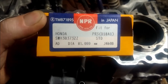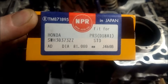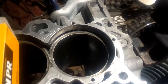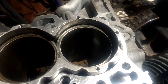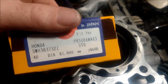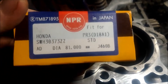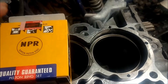Confirmed garbage. I know some people have had luck with them, but most people have not. They say they're an 81 millimeter, and that's exactly what they are — fully compressed they're 81 millimeters exactly. So if you've got slightly worn cylinders and you're pushing the 3.190 inch envelope, you're going to come up short with these rings. After trying to gap these rings, my second ring — which is what I got first and then stopped — came out to a 40-thousandth clearance. That's a no-go, not going to happen.